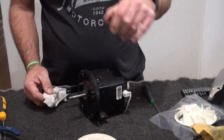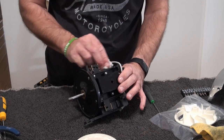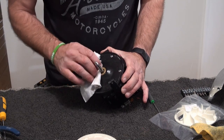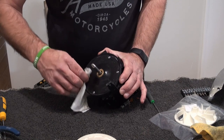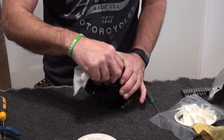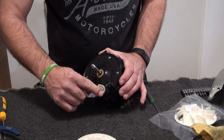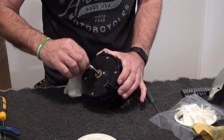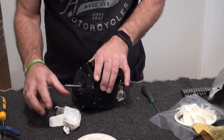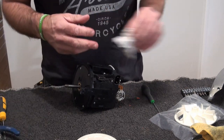For those of you that are just getting into Kirbys, I used to demonstrate Kirbys back in the 90s and started off with a G3. That's why I bought a G4, when I knew no other vacuum was good or would do the job it's meant to do. But yeah, the G6 was when it was brought out, because you got the G3, the G4 and the G5, and they were all 700 watts. The G6 was the first model to have the modified bag. They modified the boot on it, so I think that's why they reduced the power output, because they were getting more airflow with that new bag assembly.